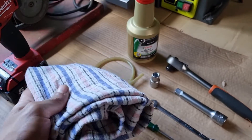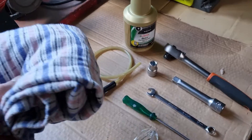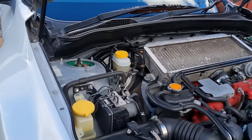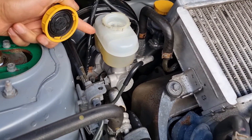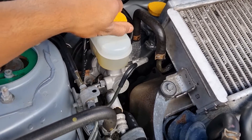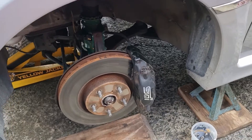Get a rag — this is quite important. You might need it around the master cylinder or around your paintwork, because if you do drop brake fluid you want to clean it off immediately. We want to start off by checking the brake fluid level. Notice how it's below the max line — top it up to the max line and then go ahead and close it back.